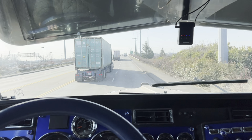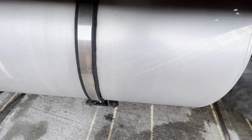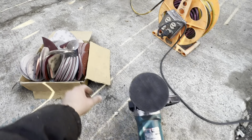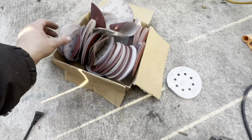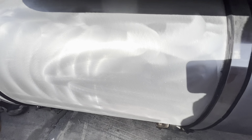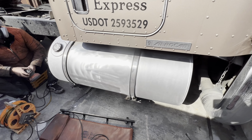We're going to be polishing and buffing out this tank. It's very pitted — probably hasn't been polished in about 20 years. We're using a Makita grinder with a five-inch pad and regular velcro sandpaper, starting off with probably 80 grit since it's pretty pitted. We definitely need to remove the oxidation. No matter how long you work it, you still can't get all the pitting out — probably need a whole day of sanding just to get it all out.